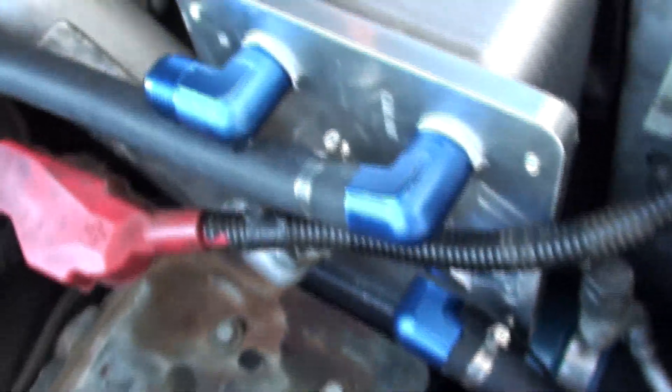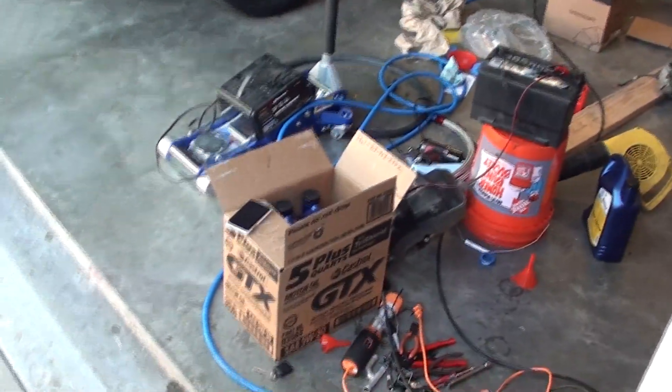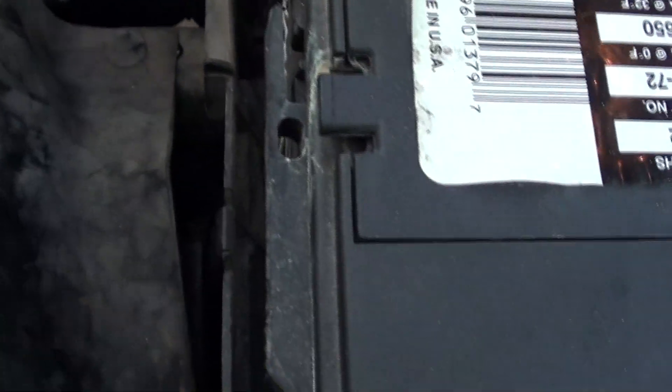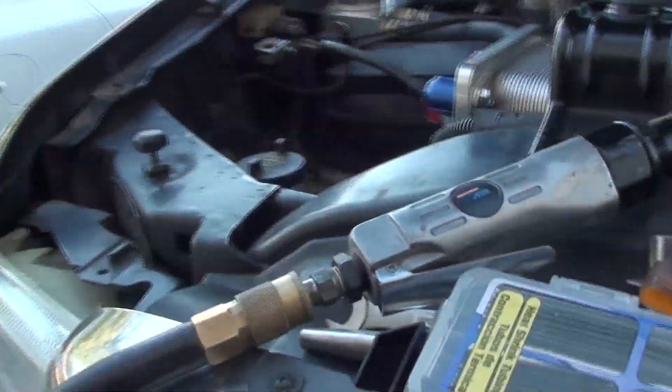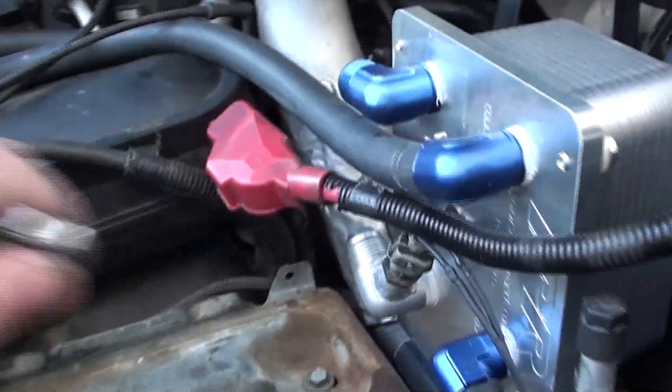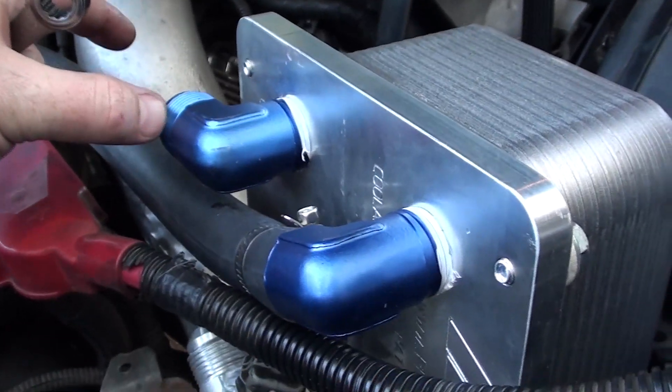The only other thing I'm kind of concerned about is the battery. I did a little look at the actual recommended battery for my truck, because I can't remember. These are cheap old batteries and they're actually about ready to be replaced. I'm going to put some DieHard Platinums in there instead. I wasn't sure if these were actually smaller than normal ones. They're actually the right size, so I should be okay. But you'll see once I get the battery back in this side that this terminal here is really close to this, especially with the metal piece.